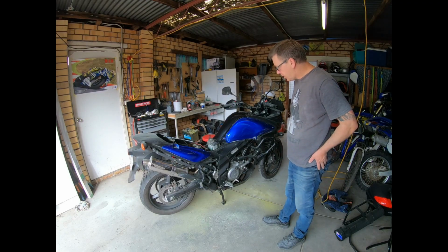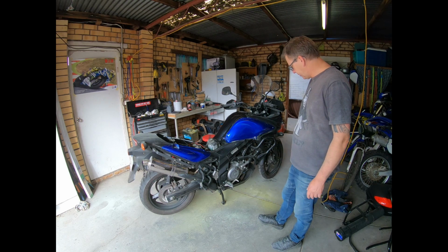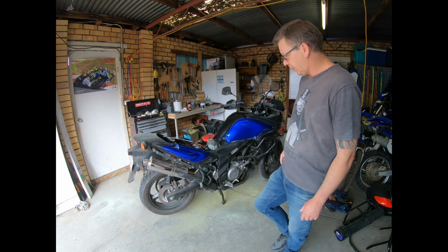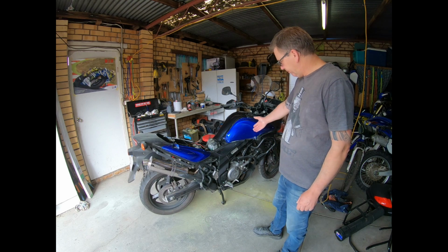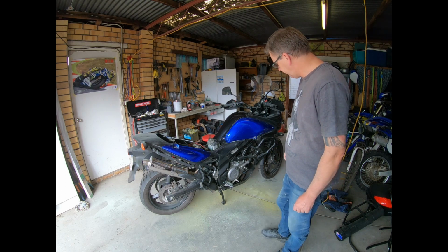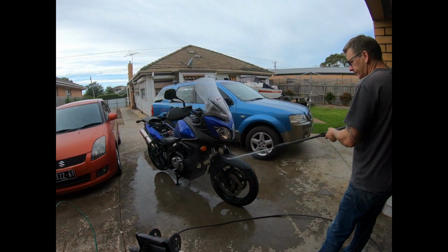Alright, so I've just finished buffing it all up. It's got a bit of mess all over it, so I'm going to now take it out and give it a good pressure wash down and give it a scrub. Get the compound out of everywhere. Now, if you're using 2-pack, you can avoid doing this pretty much. But doing it at home in the shed, I just thought doing acrylic is cheap and easy, and a bit safer for the health. You'd want a proper spray booth. The old 2-pack's a bit poisonous these days. So I'll get her out and give her a wash.